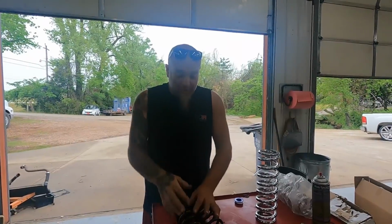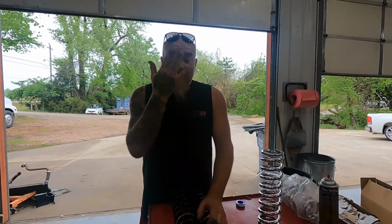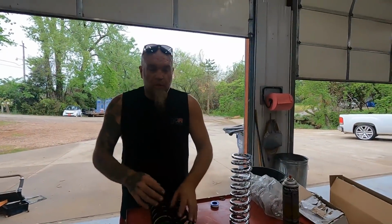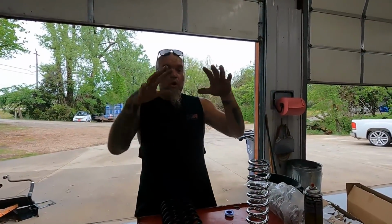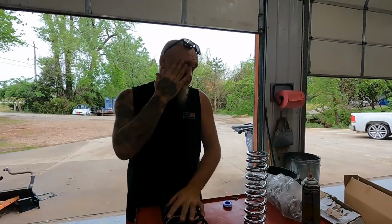The spring, once it starts collapsing, it does whatever the hell it wants to do. And I believe it's very unpredictable. You let off the button and the back of the car can do this, or it can do this, whichever spring gives out first. Yep. It's definitely going to upset the chassis, and I think that's what we had going on.